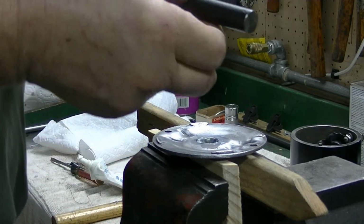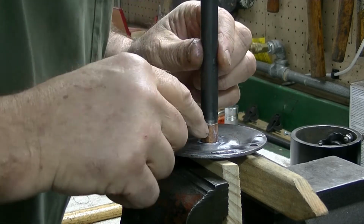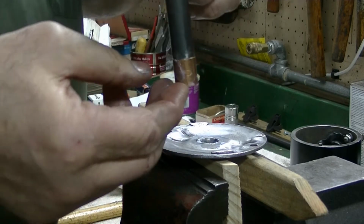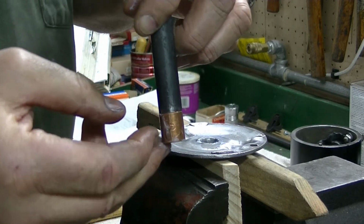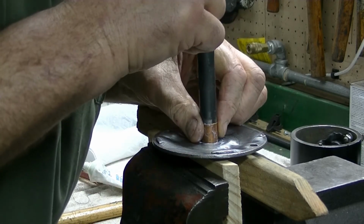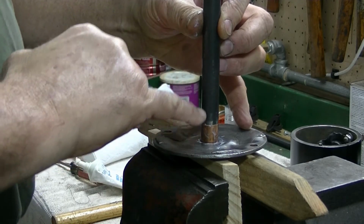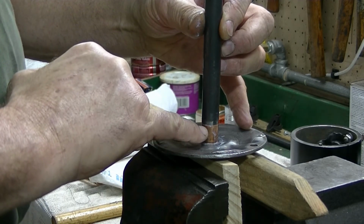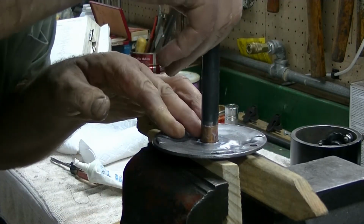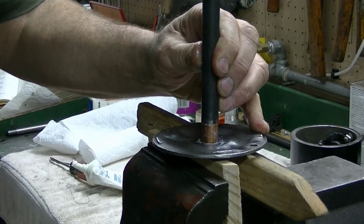Alright, I did figure out that I don't want the weight resting on the seam, you can see it where the bushing's put together right there. So I put that in line with the holes, so at rest it'll be bearing either here or here. So let's cross our fingers, say a little prayer.